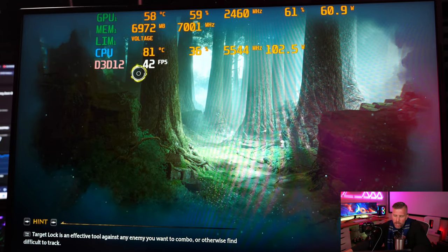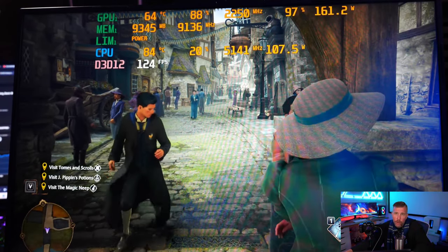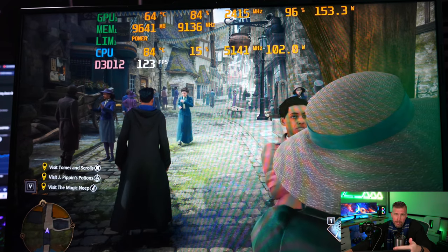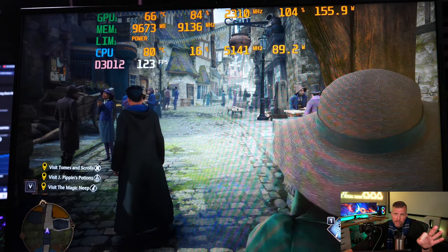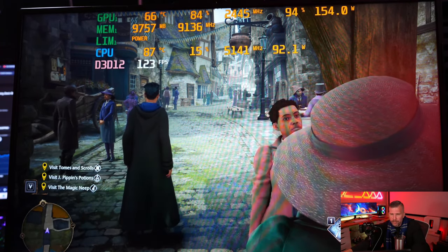So the GPU clock on the Armoury Crate, I think, is like 300, and memory clock's 500 is the cap. But I was able to overclock the memory last night in Time Spy to like 1100 megahertz on this laptop, and it was still stable at that point. So I'm not sure how high you can go on the memory overclock.